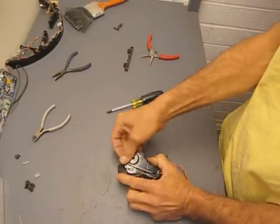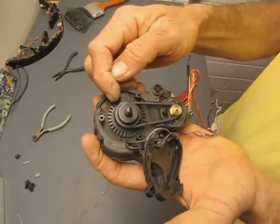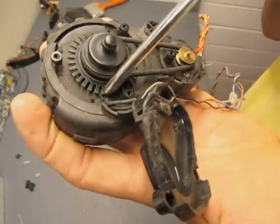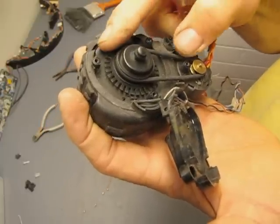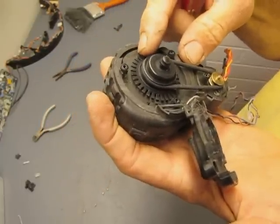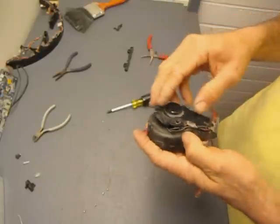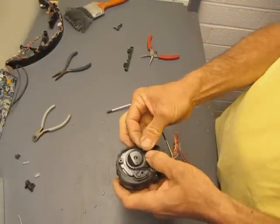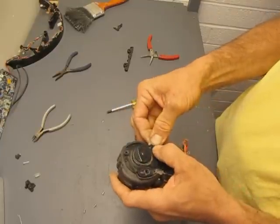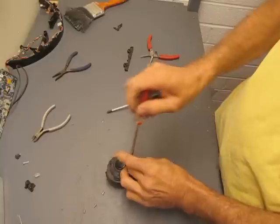And this cover comes off, and there's the drive belt and the wheel sensor. Right there is a small infrared device, another transmitter and receiver, and as these wheels go by, it breaks the beam or not. It bounces back, and then the thing can keep track of how many wheel rotations are going on. But I guess they're not that accurate because of the belt. The belt makes things slip a bit, and so therefore you end up getting a little bit extra stuff added in all the time that isn't really there, as if it traveled some distance and it didn't.